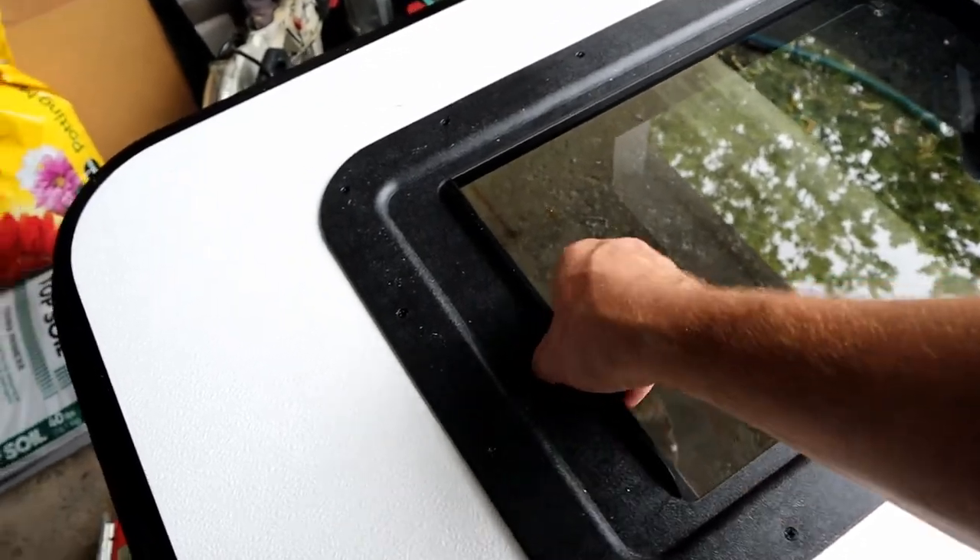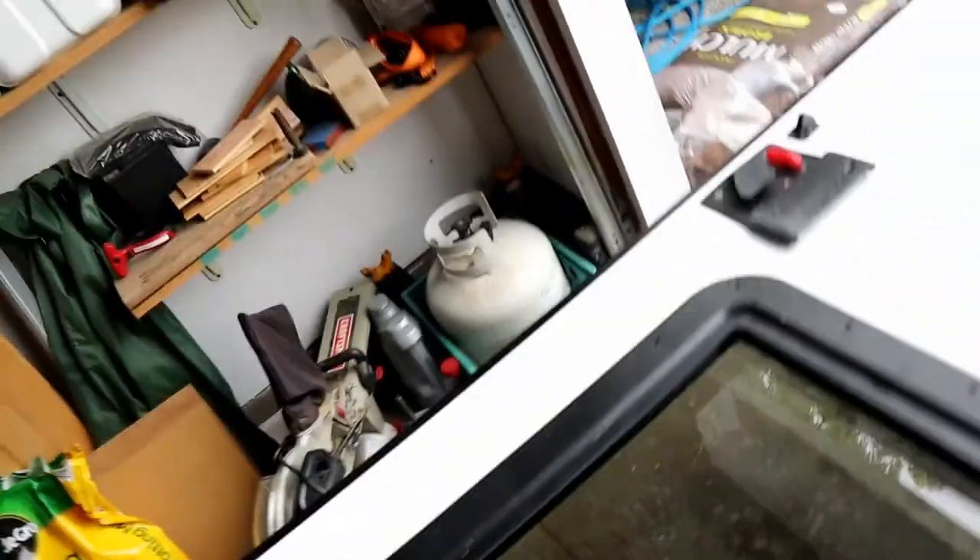The window is in. It's got a shade built in that pulls up and down, and everything seems to be okay. One big tip for this: don't let the glass hang there, because it's just stuck on with a little bit of this sticky sealant stuff. Mine almost fell and it would have hit concrete and shattered. So when you go to put the window on, put the door on the ground sideways standing up and then clamshell the two pieces together. Or you could use two sawhorses right under it to hold it up just in case. I would do the door sideways.